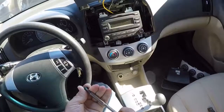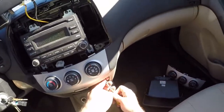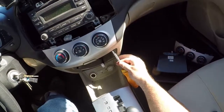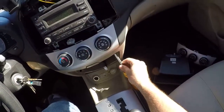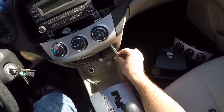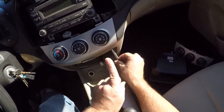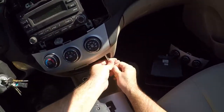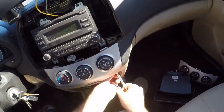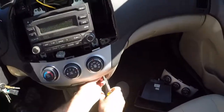And when you're putting screws back in or bolts back in, it's always a good idea, especially in wood and plastic, soft materials that the screw can chew up, but really anytime you're putting screws and nuts and bolts back in, it's a good idea to put the thing in place and then turn it backwards, while keeping pressure towards the screw until you feel it pop. It'll kind of ramp out, it'll push back, and then it'll pop in, and that'll let you know that your threads are lined up. I call that back threading, or somebody told me it was called back threading, but that lets you know that the threads of the screw are lined up with the original threads of the hole, so that you're threading back into the hole.